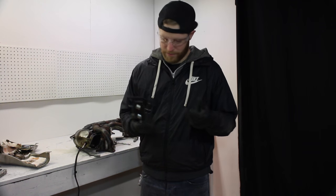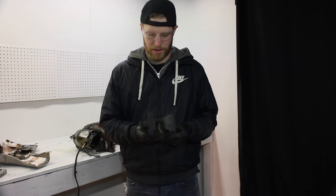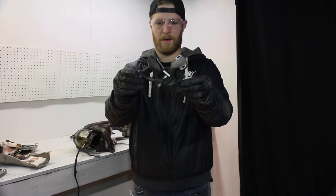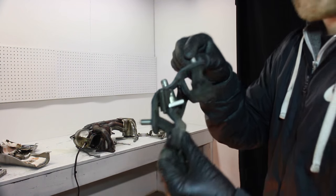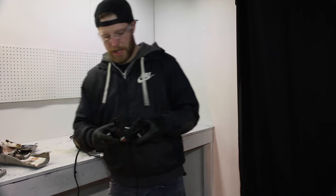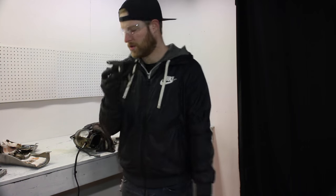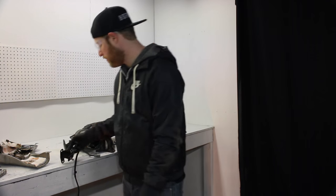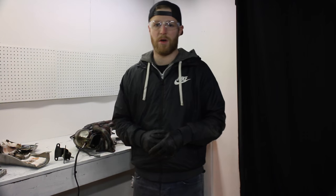It's never easy - we've hit another roadblock. While I'm underneath the car, I looked at the transmission support and I saw what's left of our transmission mount. It's supposed to not look like that - it's demolished. It's a $50 part, it needs to be replaced. It goes above the exhaust and there's actually a bracket that comes down and hangs to the exhaust from here. So I need to replace this before I can finish our exhaust, which is a bummer. In this episode I'm not going to be able to finish the exhaust - that's a Subaru or aftermarket part I need to order.